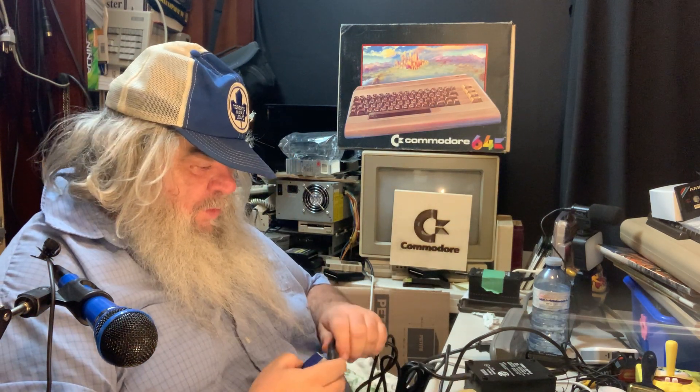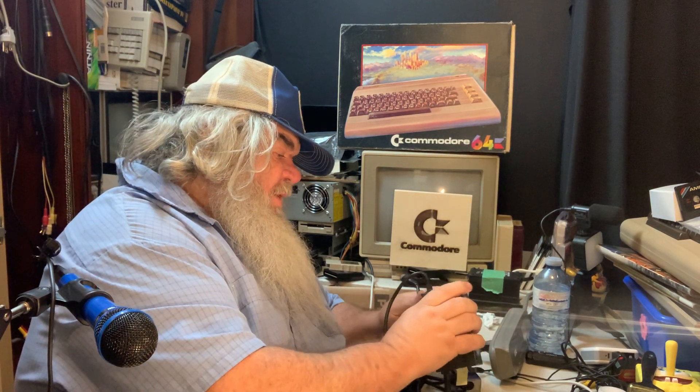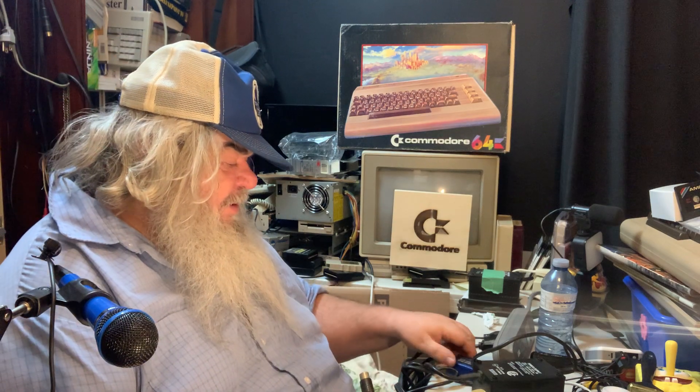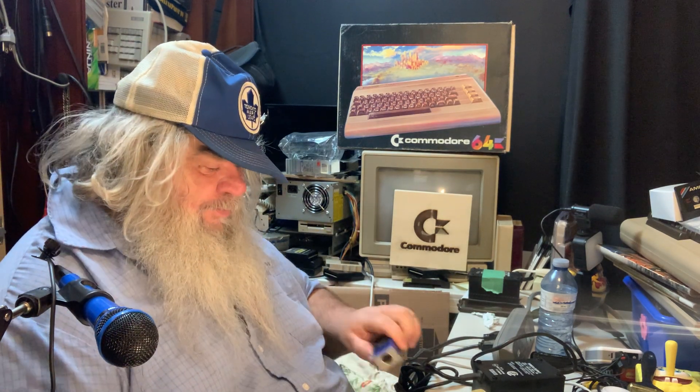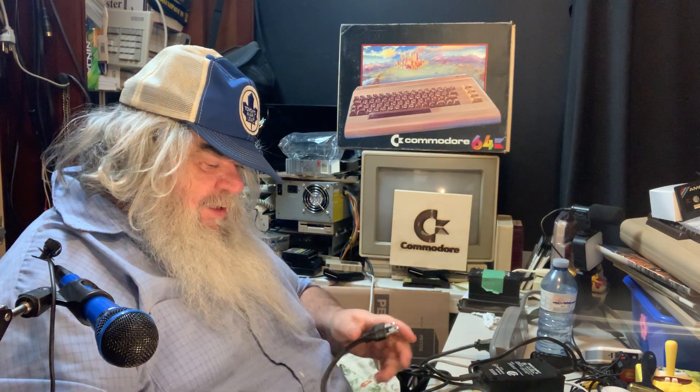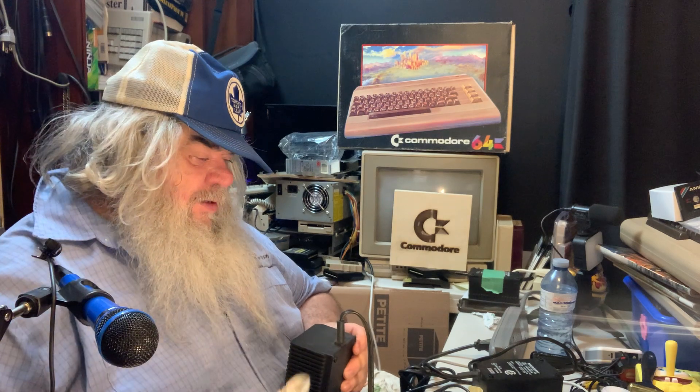It says 5.19 — that does seem pretty okay, so there is potential. We'll leave that plugged in for a bit. This one had a note: zero volts DC, and the 11 volts was 10.92. Well, if the five volts is zero there is nothing to be done but cut the wires. And indeed there's nothing there, so we'll unplug it first — don't want to cause any smoke or flames or short circuits — and we will behold the magic snippet of wires because it is not good.